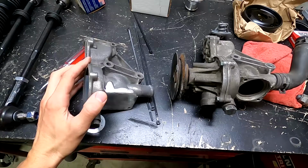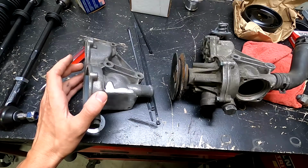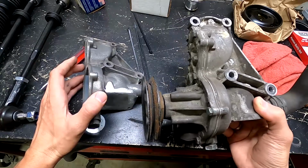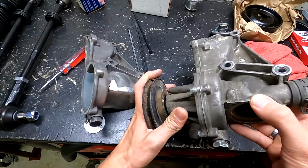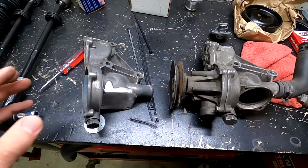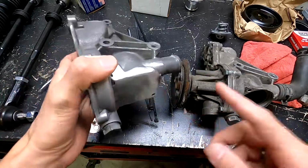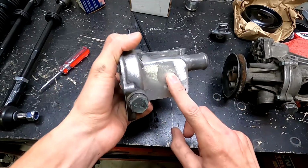mechanical, and I was trying to figure out for the longest time how I'm gonna do it. And I had one of my subscribers send me a picture, which I appreciate a lot, of what he did to his. And this is a stock water pump. The issue is the steering column hits right here, and in order to make this work, I basically got another one, since I have many engines, and I welded this hole up.